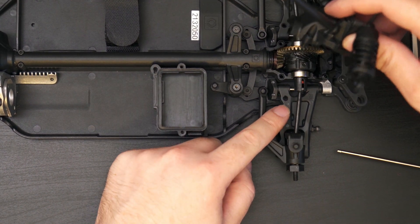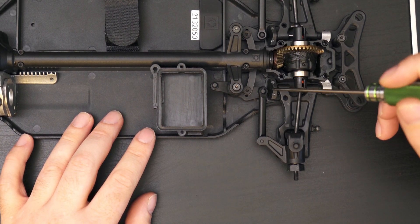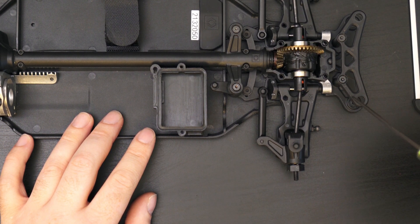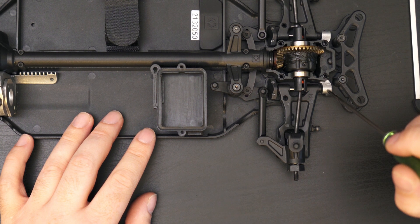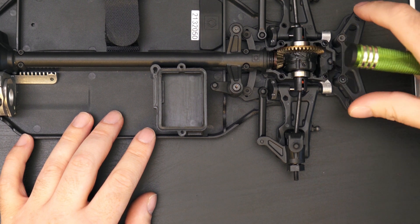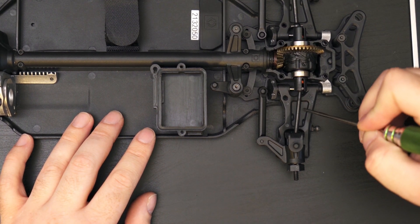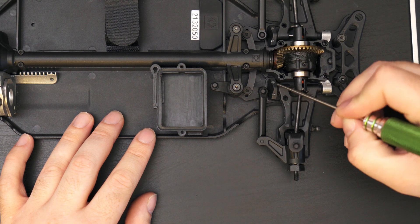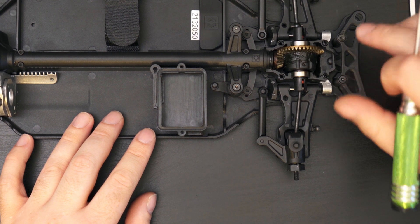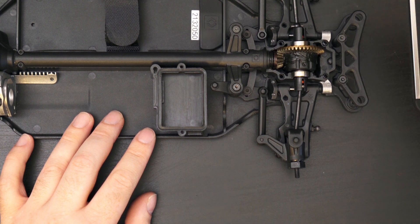Looking at the lower arm assembly, in order to remove the arm you just pop off those two screws from underneath and then this arm lifts up. There's a ball joint in the side so it should just rotate out. Obviously if you needed to you can completely disassemble it — if you snap one of these in a crash you can change it in a matter of minutes: just remove those two screws, pop the knuckles off like we did to access the diff cover, and swap it out really easily.